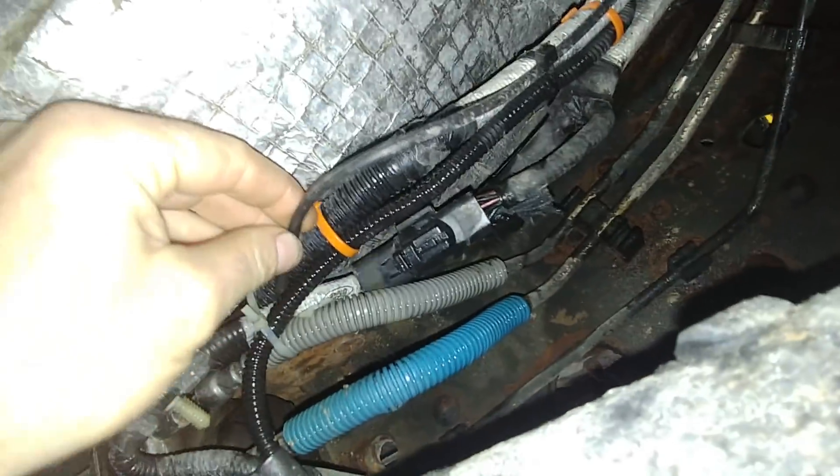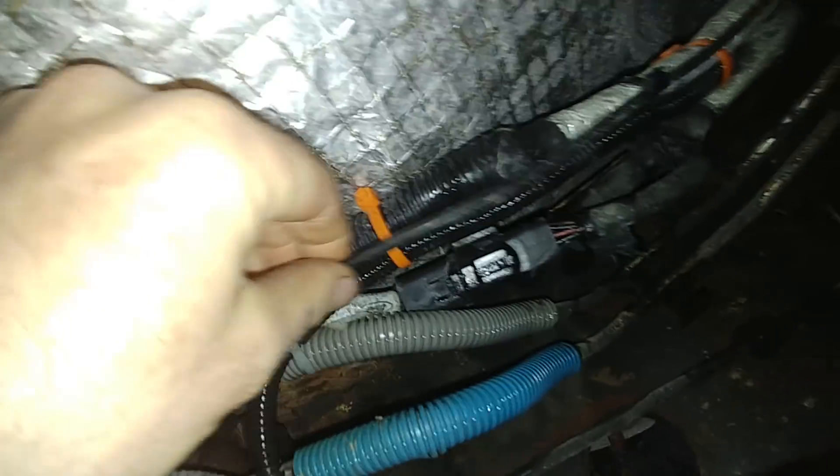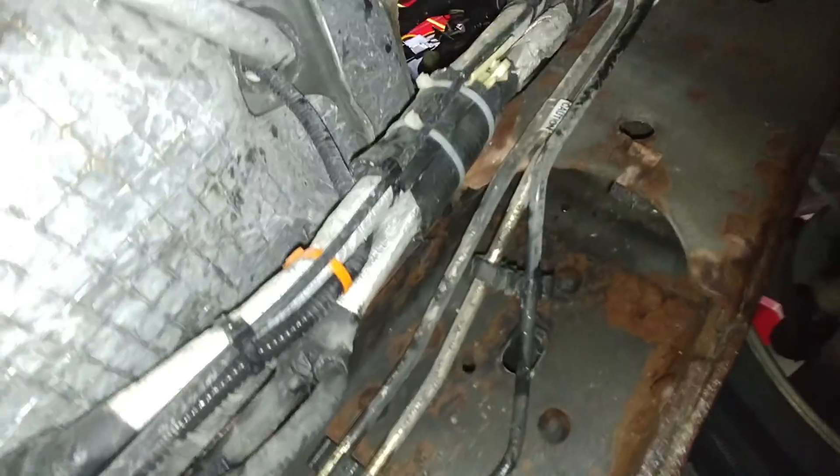Coming right from the fuel pump. Let's get under here. So I'm under here and I look at it, and they had this line right there zip-tied up on the fuel lines. This line right here was zip-tied up — coolant. I thought it was fuel, because it was literally in this zip-tie right here, and it was pouring out. I thought it busted a fuel line, which is pretty freaking rare, and it was just pouring everywhere. So we chased this hose, chased it all the way up.